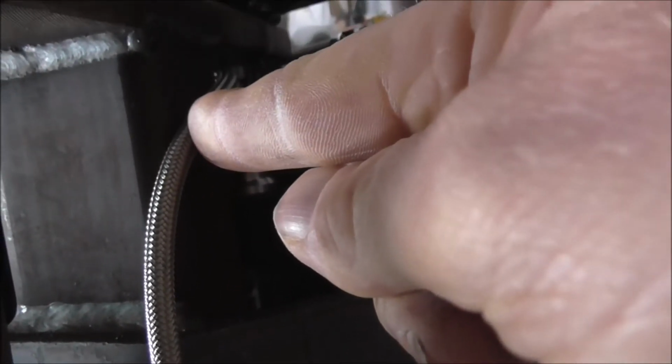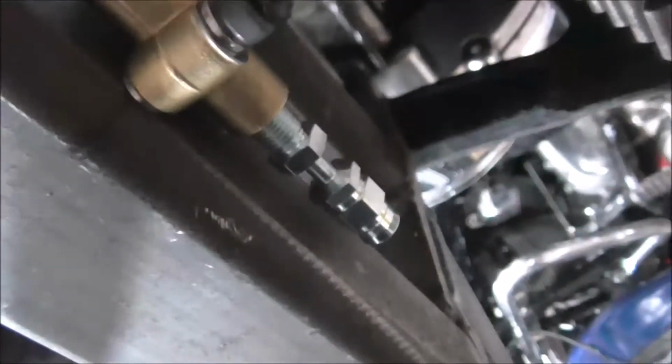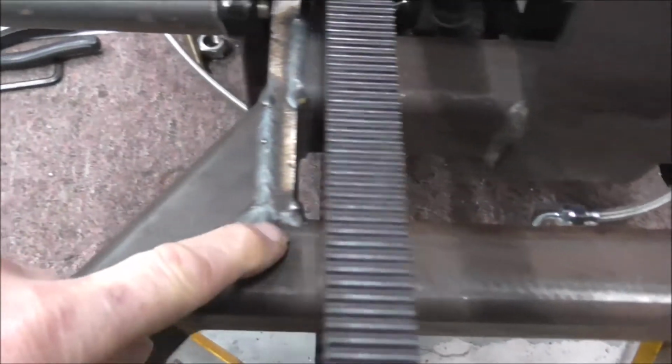That'll be up sort of straight, but there'll also be a clamp screwed on to there to hold that pipe up against the bottom of the swing arm, and then it puts that in line. Then you've got your two bits equally spaced, and then I just need to run the lines down there to the calipers. So the line will come along from there, come along from that T-piece underneath, and it's going to run up